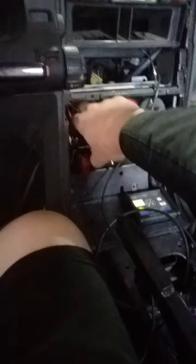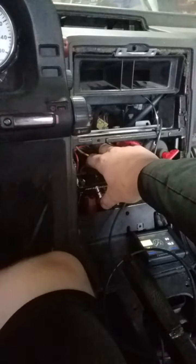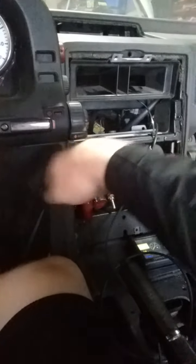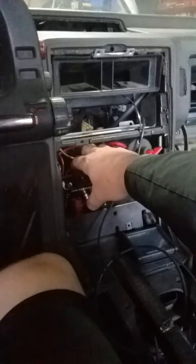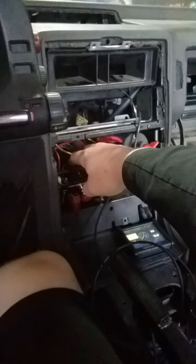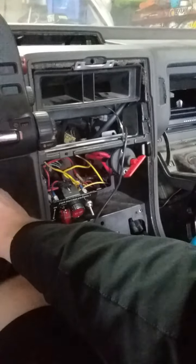Let me try one more time. We'll give you my point of view. Here's the key, ECU, and the handheld. It sort of fired up for a second. It's wanting to — it's right there at wanting to start. Maybe the power wire from the starter is just a little too small. I think I got a 4 gauge — I probably need a 2 or a 0. You can tell it loses its amperage real quick.